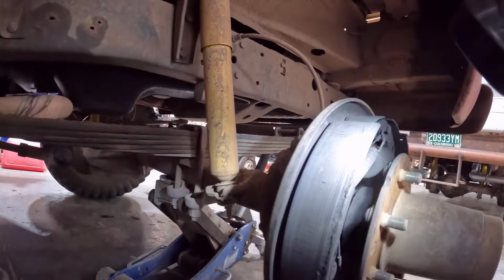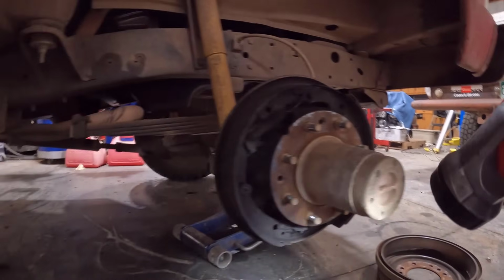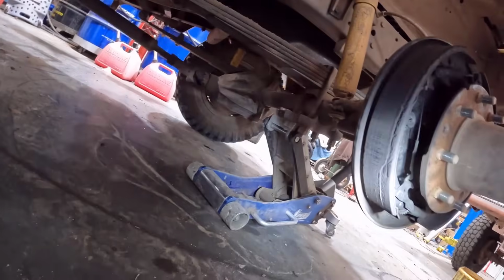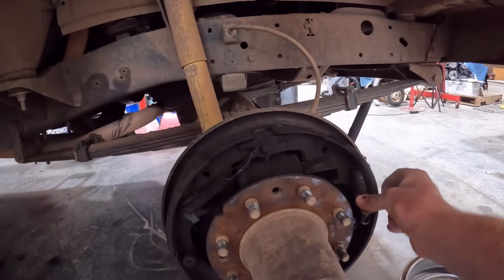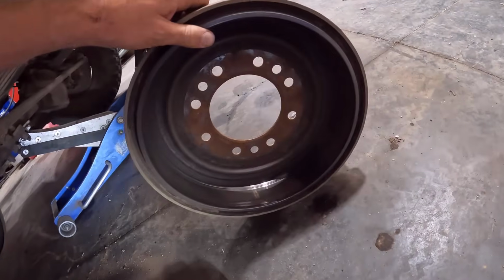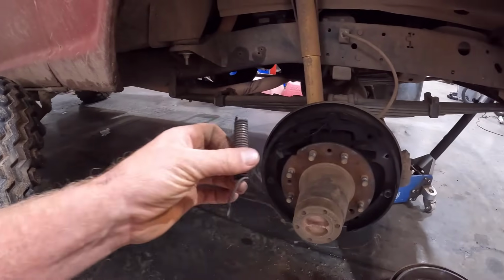So it looks like maybe part of the spring got wedged in here and was starting to chew up this shoe here. I guess that might have been why it was getting hot on me and why it was making a bunch of noise, if that was wedged up under there. Although I don't see any pieces that fell out, like the hook broke or anything like that. And this piece was still hooked to the shoe there. So I don't know, but I guess I'm assuming that's what happened. I mean, the thing was still making noise even as I pulled it in the shop. But this was still attached over here and just hanging down here like this. So I don't know why it would have been screwing up with this shoe over here. But anyway, I guess we're going to just assume that is the problem, since it looks like it's an issue there. So I'm going to go digging around with some of our brake parts and see if I find one of these springs, and we'll see if we can get this thing put back together.